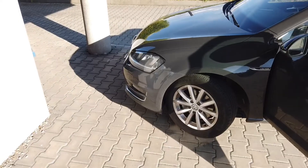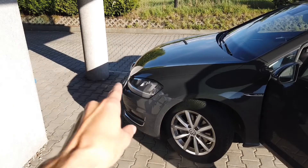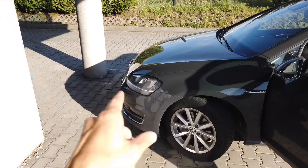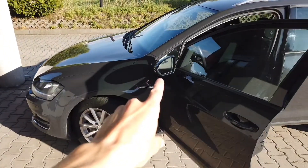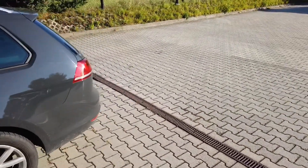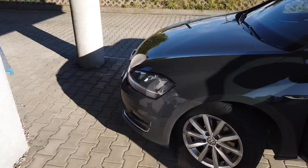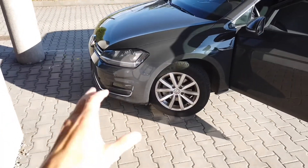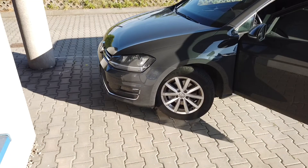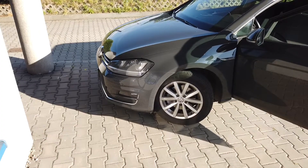I'm doing this because recently I changed the coding of the welcome lights to not use the low beam Xenon lights, and to use the fog lights instead. When I open the car, the fog lights come on as well as the lights under the mirrors, the rear lights, and the number plate illumination. All those lights are LED and only the front fog lights have standard halogen bulbs — I don't like this color mismatch, so I'm going to replace those bulbs with LEDs, and then I'll need to change the coding of the fog lights to avoid a broken bulb error on the dashboard.